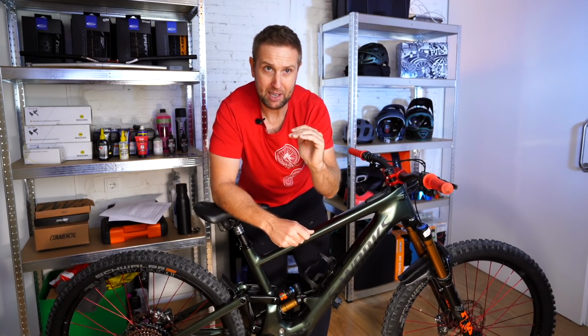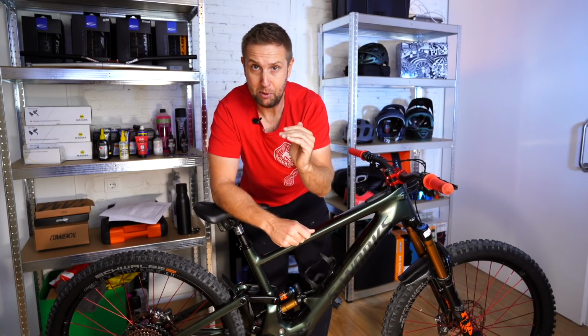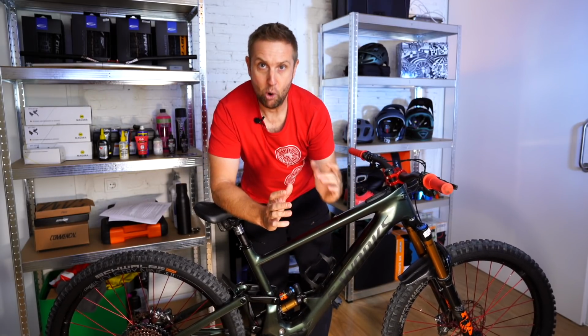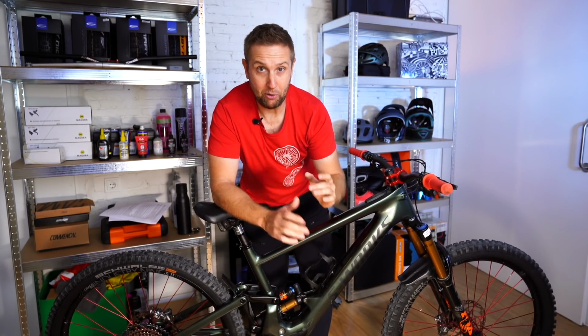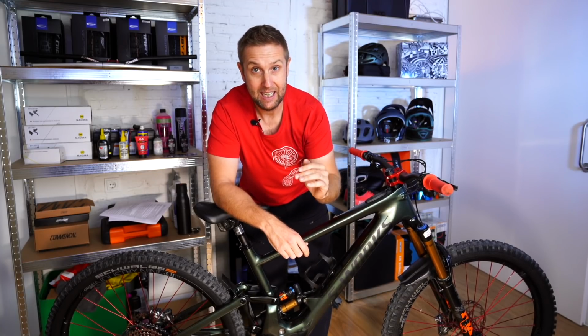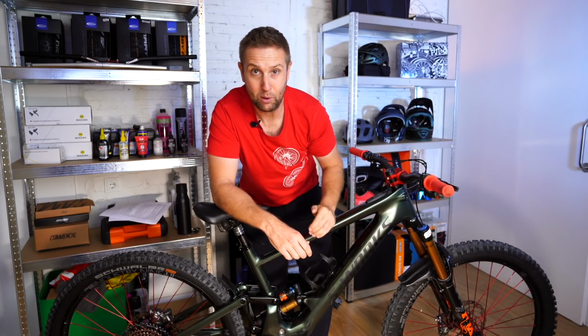It's going to make the bike feel a little bit more lively and be able to turn a little bit sharper and faster. And when you go in the low setting, it's going to make it feel more planted and just more dialed. But riders, in the low setting, you really need to look out for the pedal strikes and the rocks, because the bikes do sit quite low.